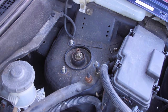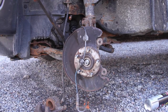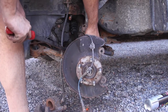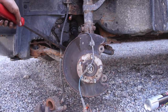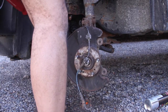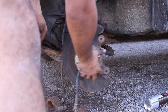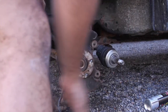the, what is that thing called? The control arm, so it's still kind of stuck. Now you want to take your pry bar underneath the control arm, push down, lift up on the assembly. I'm actually gonna put a nut back in the strut. Make it a little bit easier for me. Okay, so now push down. There, now it's free. And luckily, because I just put the CV shaft in, this CV shaft comes out freely.